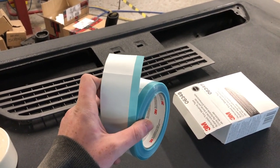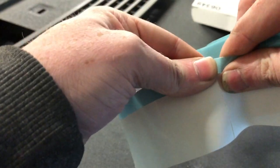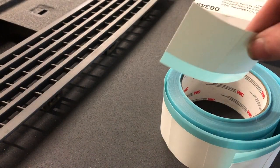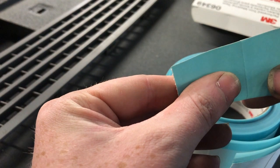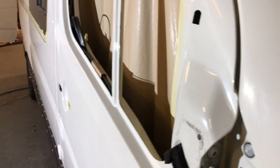I've also got the scuttle panel to prep — only a little piece, shouldn't take too long. I've bought something to try for masking the windscreen: a specialist trim masking tape. You rip a strip off, take that little plastic piece and it goes into your rubber seal, then you wrap the self-adhesive section around. So you don't have to remove the windscreen — you just come in to the edge of your seal, slide it up and down, put it taut and nice and tight. It creates a gap so you're not going to have any hard lines on your spray.